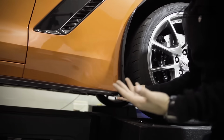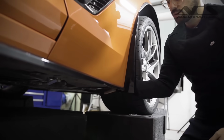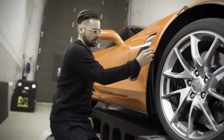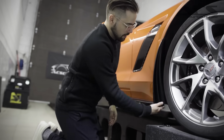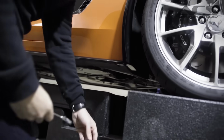I mean, there's really no other special tip that I can give you other than just start from the bottom, push one way in, and then slowly lift your hand up and push in the rest of the clips. You'll know they're installed properly once the seam between your front fender is seamless, really. There should be no gaps between it. It's a nice tight fit, and then once you have it matched up, you can go and put the screw in.